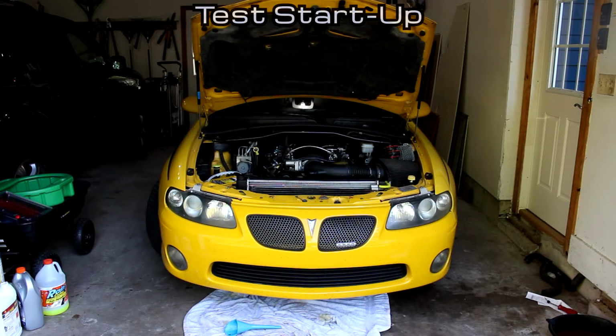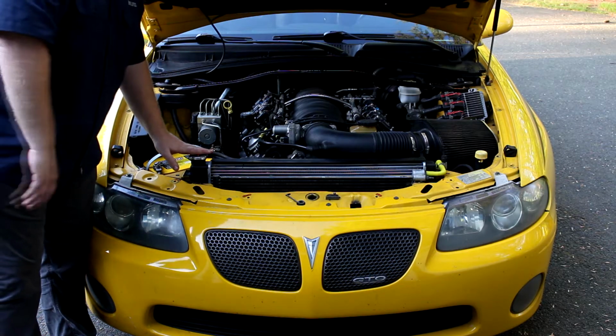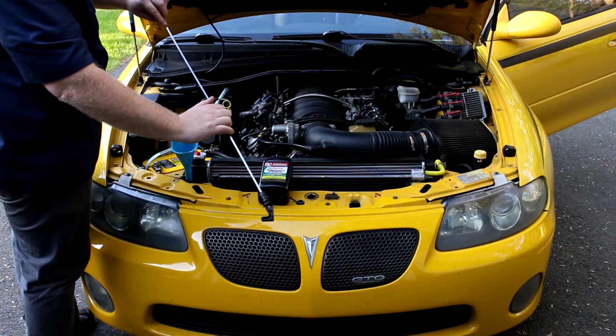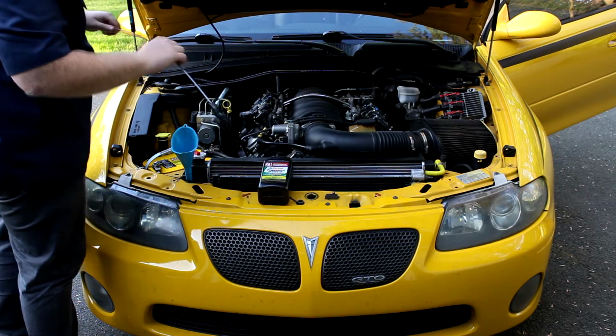At the end, you obviously have to get the air out of the system, but don't forget that you also lost a little bit of transmission fluid, so check that level as well. Deep pan only, check in park, engine idling, vehicle level.